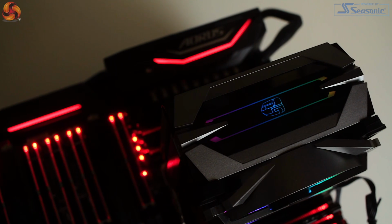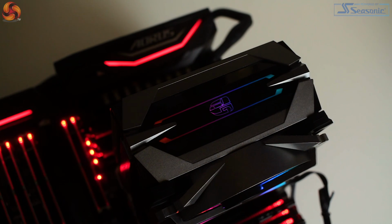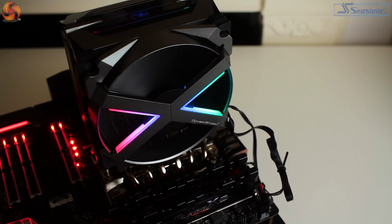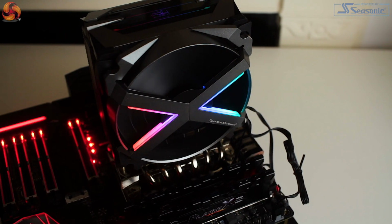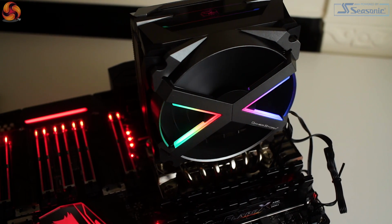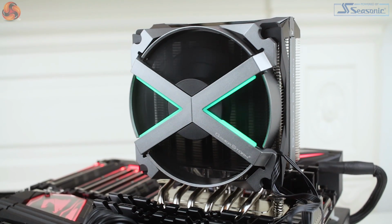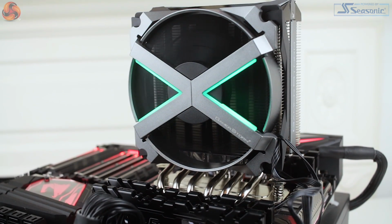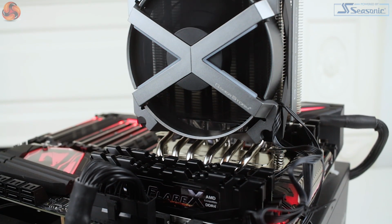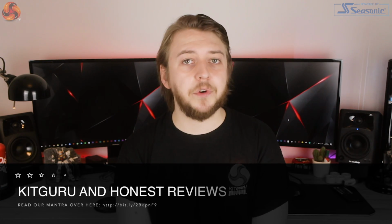So to summarise, the FRYZEN cooler is a bit of an interesting one. For starters, it's really well built and feels super solid and premium, even down to the fan's construction, which favours aluminium over a standard plastic frame. It's also nice to see a bit more varied compatibility with mounting options for older AMD sockets as well, as a number of TR4 compatible air coolers are basically only compatible with the TR4 socket. Aesthetically, I think it looks pretty good, and the inbuilt lighting also pretty awesome, without looking tacky or, say, over the top. Really, the only area the FRYZEN cooler falls a little bit short is in performance when compared to much bigger, heavier dual-fan coolers. In this area, you are sacrificing a little audible noise as well.